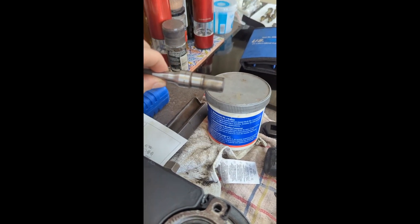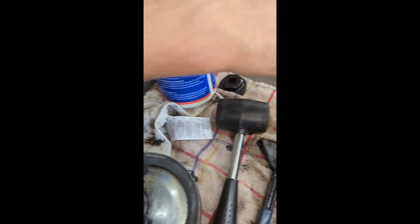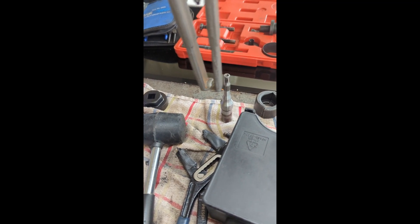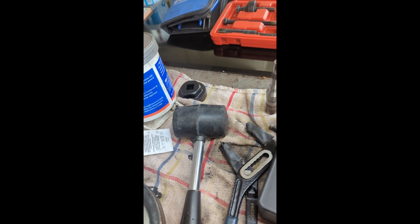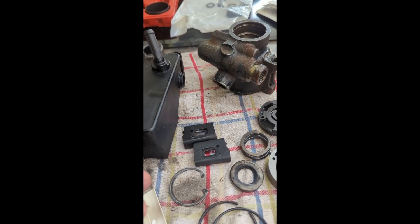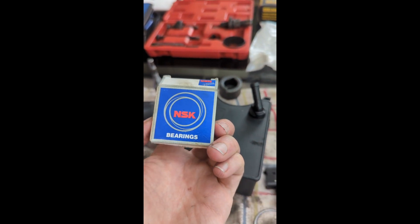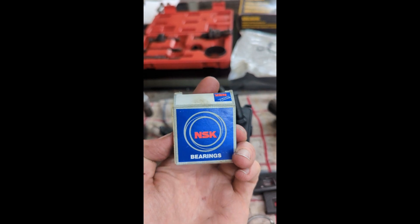When you get the shaft out, you'll want to pull the bearing off — it's a press fit. You just need a puller, get it on the end nice and tight, and push it off. It may help to use some grease to assist it on its way. The Edelman kit comes with the replacement bearing, but if you want to go to market for others, you're effectively looking for a high-temperature application bearing. I bought some separately because I didn't think the kit would include them, but there's a number on them if you want to look for alternatives. Edelman's is perfectly acceptable.